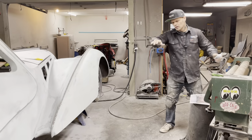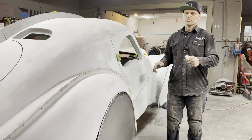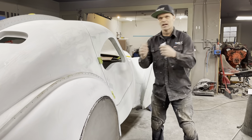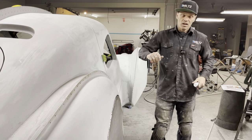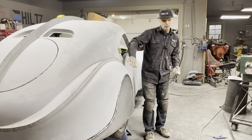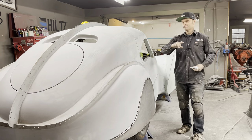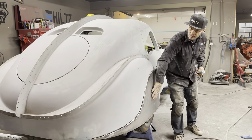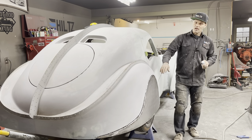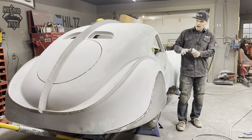As I do this, the reason I build cars this way, you have to imagine the time it would take to bend that 90 on a shrinker and stretcher and make that fit, and come back over and try it, take it back off, put it back on, take it off, put it back on. You can imagine the time it would take. If you take notice on the videos, the time, I think, is an hour and a half. We have one skinned and round rodded and fitting the fender in real time. If you can just imagine that, if you can fit it and skin it in an hour and a half and have both on in a day and start mudding, imagine the time that you have saved.